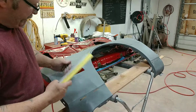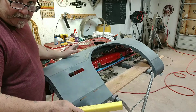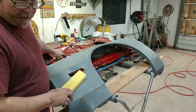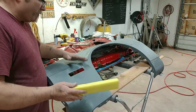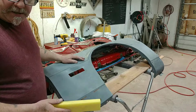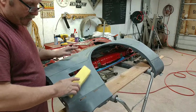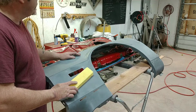But I want to give you a few tips. This epoxy primer, I had it down to some bare metal and stuff, so I just put some epoxy on it because I was done with it for a few weeks. So I got to working on these doors. But most people know that epoxy is not meant to be stacked or whatever. You can usually just use it to cover bare metal or a sealer or something like that.